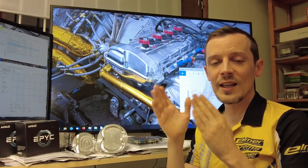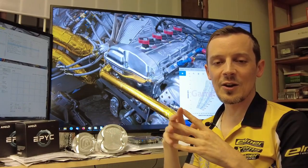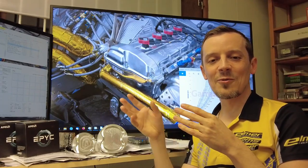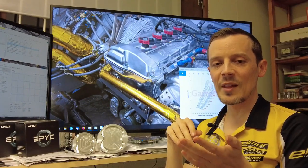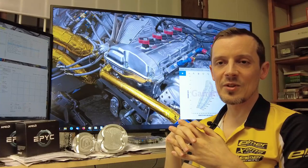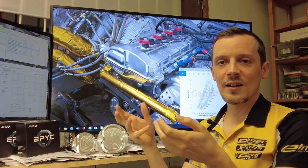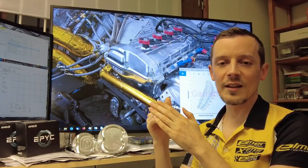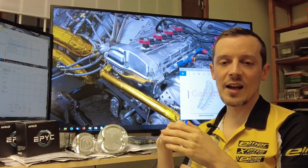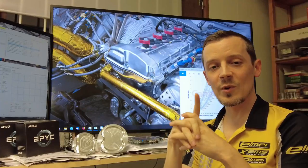Durability is also very good. Even with a hot shutdown — at full EGTs on the track — they had a drivetrain component fail, the driver got spooked by the loud rattling and immediately shut everything down, which is rolling the dice on whether the engine takes damage. But it didn't take any damage. The danger is the exhaust manifold at 800–900 degrees near the cylinder head will start boiling off the coolant very quickly once there's no coolant flow, and then components start heating up depending on their heat capacity. But it held up on this occasion — very happy about that.